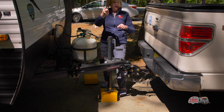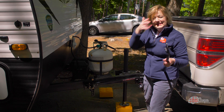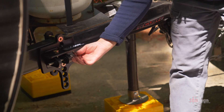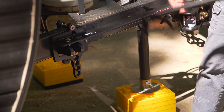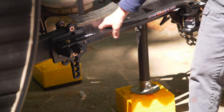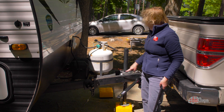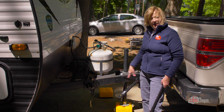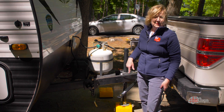I'm going to come around with my tool and see if this is ready to pop off. I gave it a couple of hardy turns and I've taken the pressure off. This should allow me to remove the cotter pin here — came right out. Sometimes it will pull right out, and it did. I take these off both sides and then I can bring this hitch off and get the truck disconnected from the trailer.